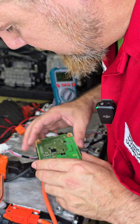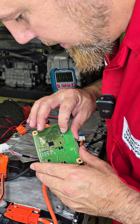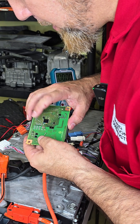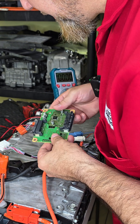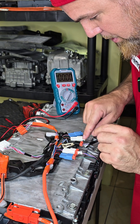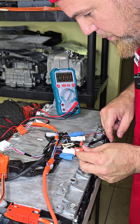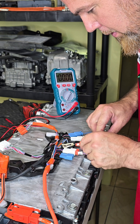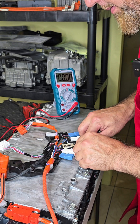Oh boy — I hope 30 volts going through there didn't burn out the computer inside. Looking at the board, I don't see any clear damage; apparently none of the chips appear burned. But this board was receiving 30 volts, so it's hard to say if one of those resistors was damaged. The root cause: the problem was not the temperature sensor itself — the short circuit reading was because this voltage sensor connector carrying 30 volts was plugged into the temperature sensor port. Look how easy it is to make this mistake.